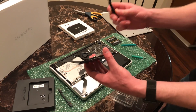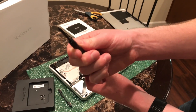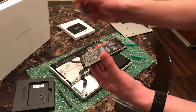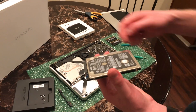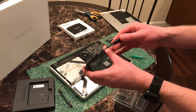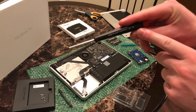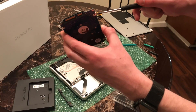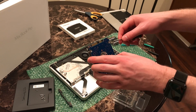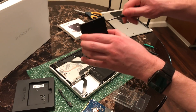The reason you need the Torx screwdriver is these four mounting screws on the side of the drive. I believe these are T6 screws. You need to transfer these mounting screws to your new solid-state drive. I'll include info in the description on the specific screwdriver you need. As we remove them from the old hard drive, I'm just going to screw them into the solid-state one at a time.